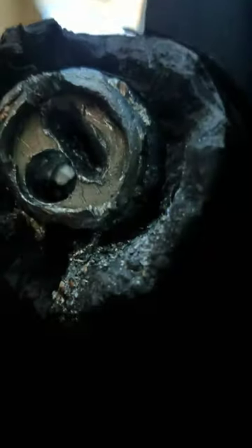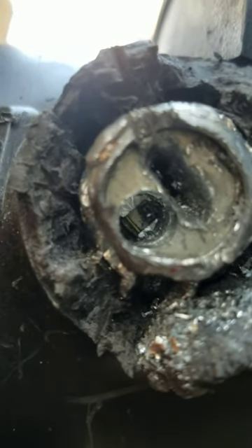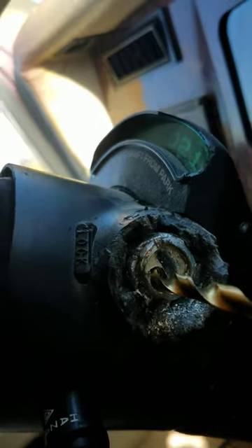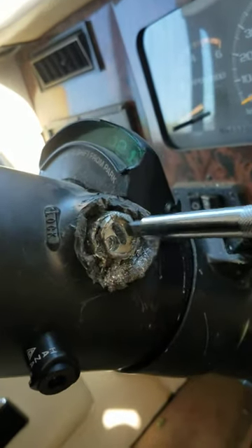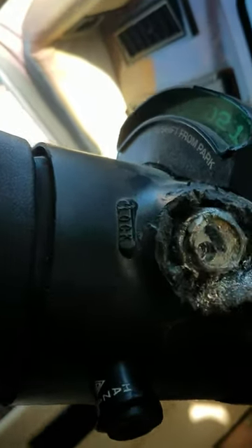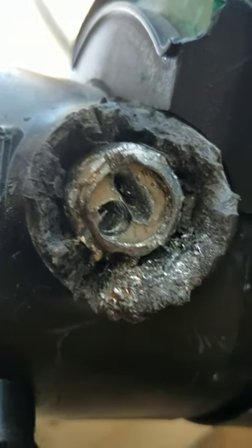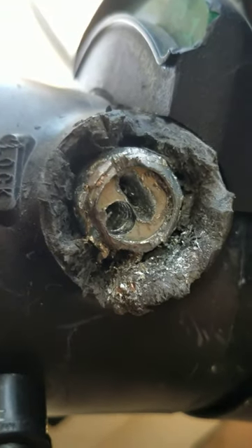As far as the depth of the hole, you can see how far I went in there — that's a pretty good view. That's right where the little locking part is, and I kept drilling in about an eighth of an inch at a time, testing with the screwdriver. At a certain point that piece came out and it started turning again. I've got the battery disconnected right now so I can't start it, but that worked.